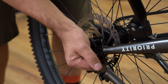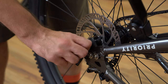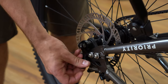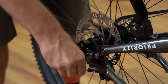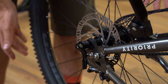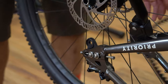Let's start by flipping the bike over. The first thing you do is open the quick release lever on the thru axle, and it aligns with a cutout in the body of the thru axle that you can use for leverage to unthread. Turn it counter-clockwise to unthread. At a certain point it will just spin free and you'll feel the wheel kind of drop loose. Remove the thru axle all the way, set it aside, and lift the wheel out of the bike.